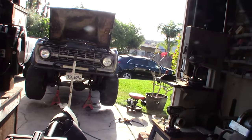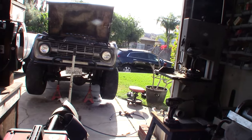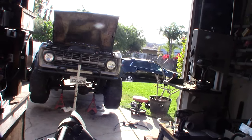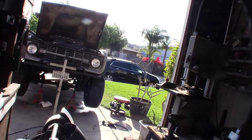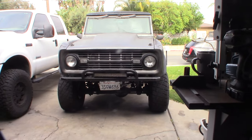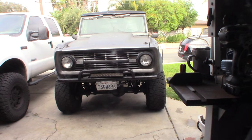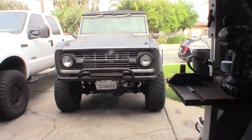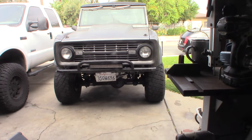I'm really in tune with this truck because it's been my daily driver for the last 20 years, so I'm very familiar with how it feels when something is wrong. I took it back out for a test drive and now there's only a 4-degree temperature difference between the two calipers. It's no longer pulling and it seems to be unlocked.